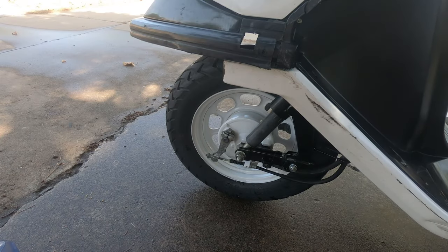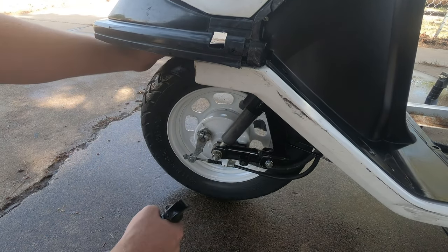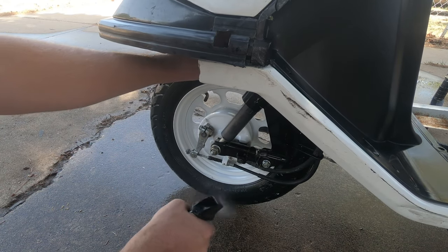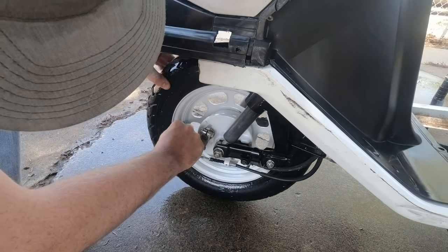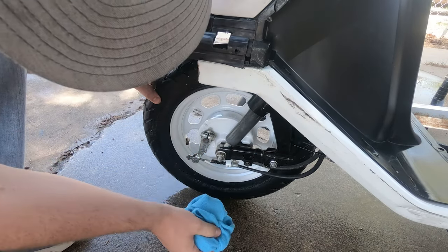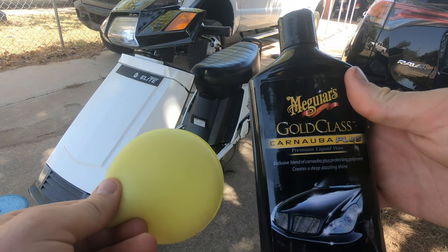So this next one's going to be pretty controversial. Using tire dressing on a scooter or motorcycle is always a pretty hot topic. Some people say if you get it on the treads, it'll cause you to lay your bike down. I try to keep it off the treads. You saw I got it on it there, but it'll all rub off within the first straight you take. Maybe if you come down your driveway and you take a pretty hard turn, yes. In that scenario, I could see it causing a little bit of trouble,